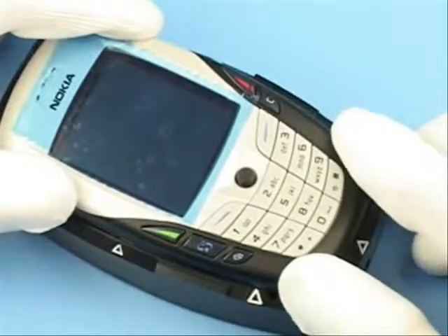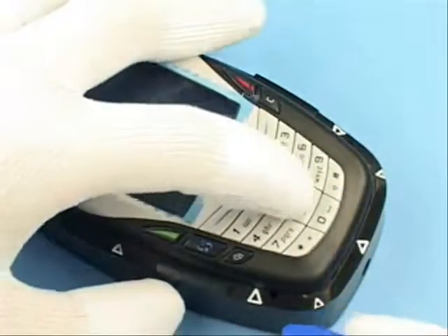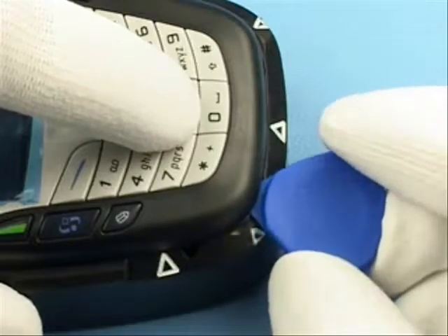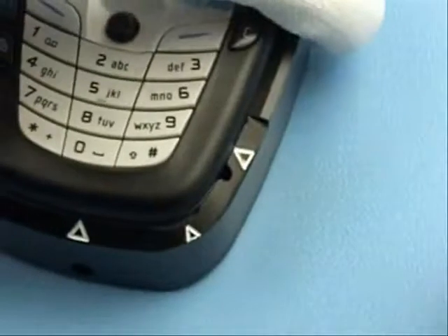Put the phone into SS-12. Start at the mark near the system connector to release the A cover by use of SRT-6. Use like a blade with moderate force only to prevent damage to the A cover.